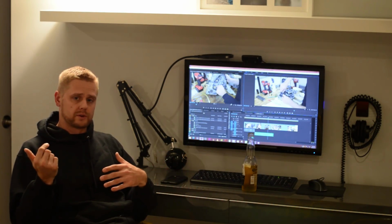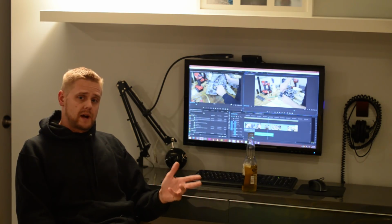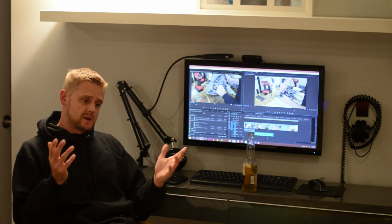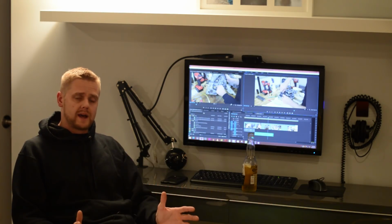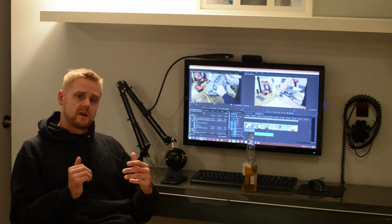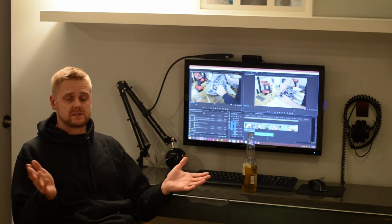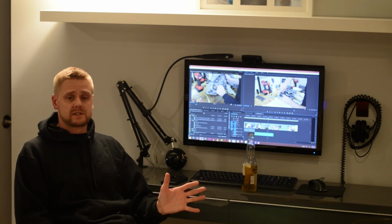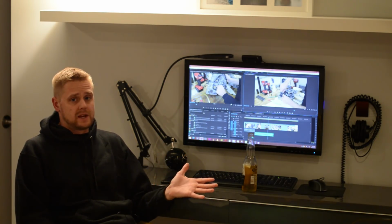So you don't have to pull the motor to do the top end, you can just do it right there, and that's how the video is shot. And also I have a valve adjustment video that is included, and that is adjusting the valves as a maintenance item. Now everything is covered in this video except for head disassembly. I don't go into removing the valves and the springs and all that. If you have issues with your head, I would just recommend sending it out to a company like Fast Heads or another place that cuts seats and sets up the valves and all that good stuff. That's something you can just farm out, and that's something you can't do in the garage.